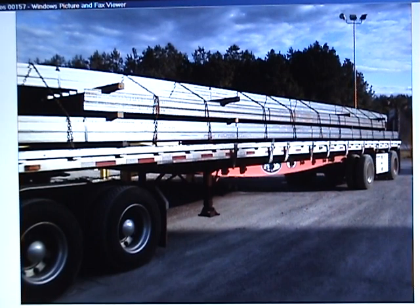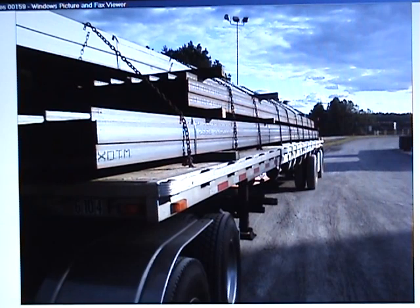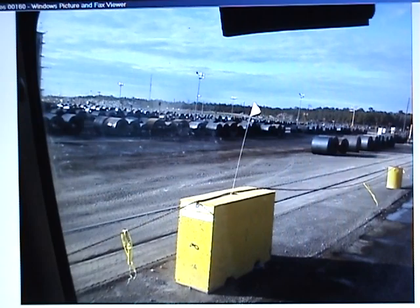Here's one of the heavier loads I haul. This is I-beams of steel. Big I-beams. There's a close-up shot of how much it hung over the front of the trailer. You've got to be careful with that, because later on you'll probably see a picture where it bent the piss out of my headache rack one time. I got it too far forward and it skinned up, and I had to slide my fifth wheel all the way to the rear in order to make it swing.